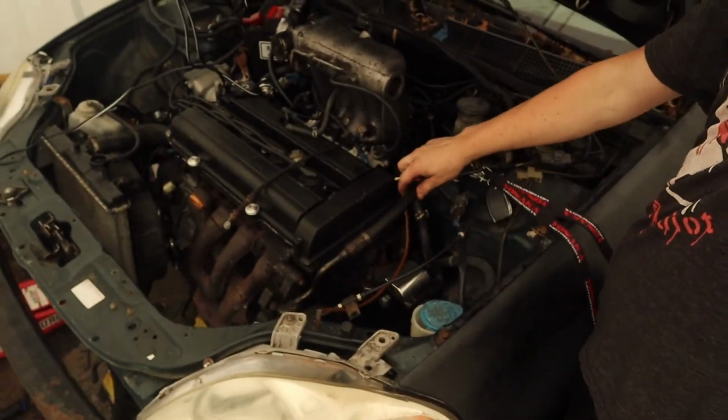I don't remember when I put my camera down, but that day I was getting very frustrated. So today I kind of just went to work, put both ball joints in, tightened everything down, got my suspension back together. Found out the smoking issue, I think, was my power steering line was actually routed underneath my engine. I don't really know when that happened. It was probably when I put the engine in. I didn't realize it was doing that. So that should fix the belt issue of it smoking out. I'm probably still gonna need another belt, but we're gonna test it and see if it smokes anymore.